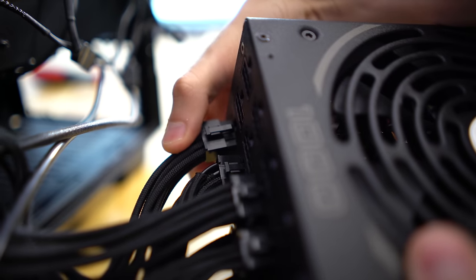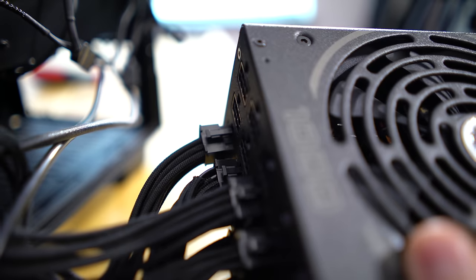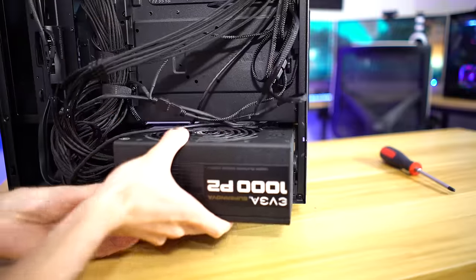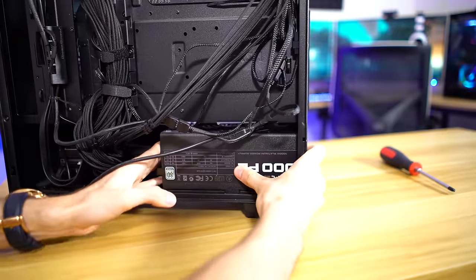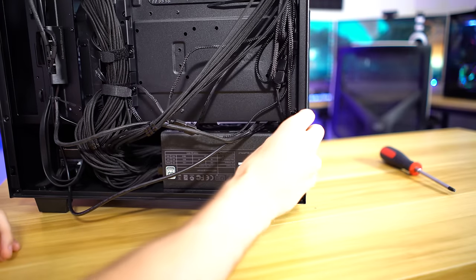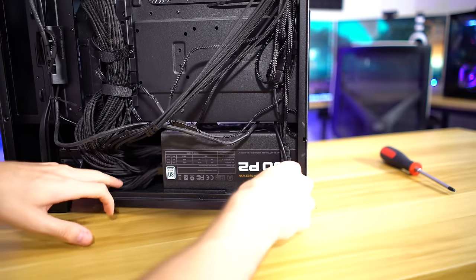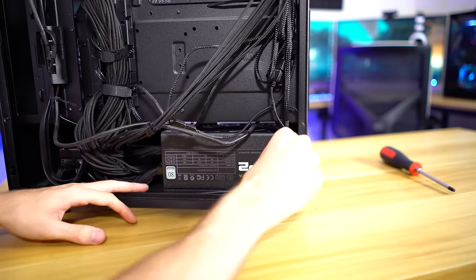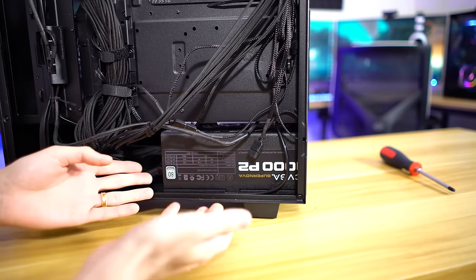I do have to turn the power supply over to effectively do this, because the VGA power cables on the power supply are sitting right in front of the right side panel. We want it to be further tucked back — we want them to have to actually thoroughly troubleshoot this rig to figure out what is wrong with it. My suspicion is that they are going to assume it's the graphics card itself and not a power supply cable. We're going to tuck it back in and I'm going to show you what Geek Squad is going to see when they power on this PC. What I believe is going to happen is you'll just see a black screen — the PC will turn on but you will not get a picture on your monitor. And this is going to, I suspect, lead them to assume it's a graphics card issue.